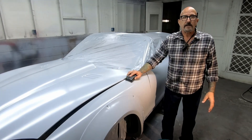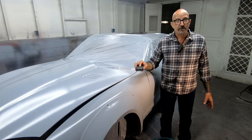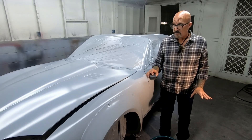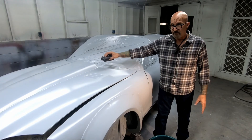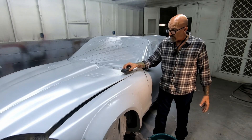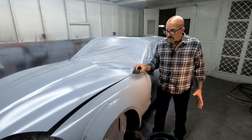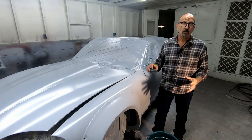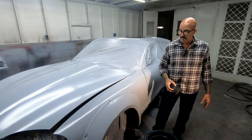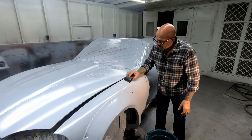Generally speaking, when I'm sanding a panel, I approach it the same way as when I'm spraying a panel with paint: worry about the edges and the middle will take care of itself. If you just start working the whole thing from the center, odds are you're going to miss stuff at the edges, or by the time you get there, you'll have sanded it so thin that you blow through and show your undercoat. So I like to work your edges before you work the middle of the panel, work into the middle from the edges — that way you've got all your edges covered before you tackle the big easy stuff.